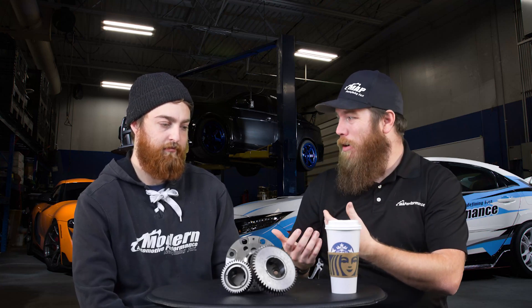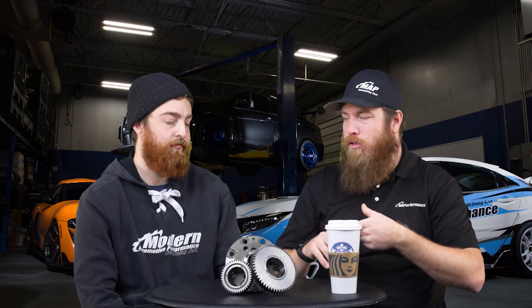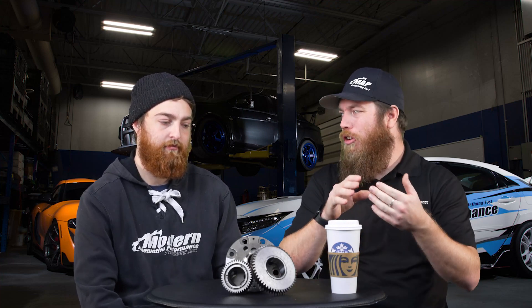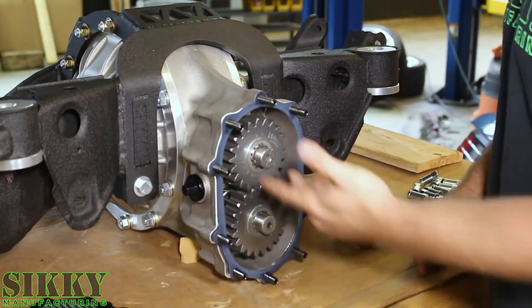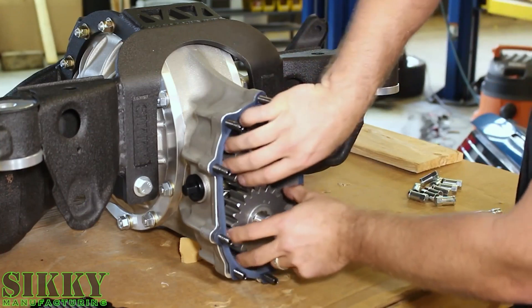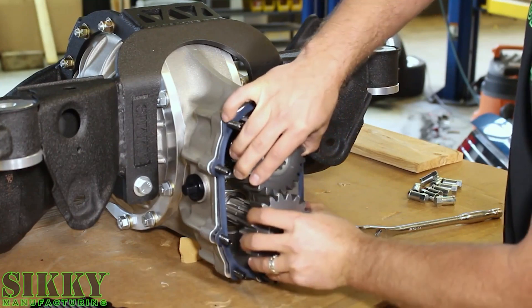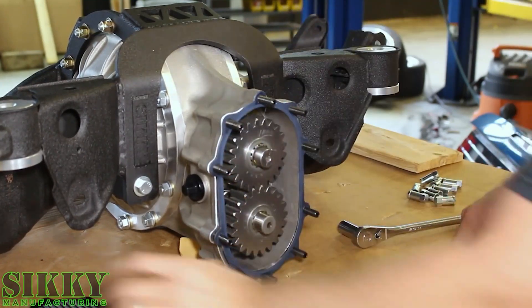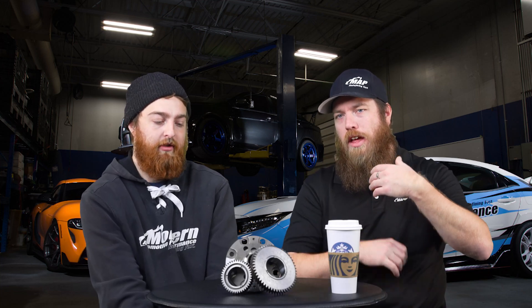One of the interesting parts about gear sets is the ability to carry a spare differential and just swap it in and out — much easier than swapping transmissions. Now in professional drifting and professional road racing we're seeing a much larger use case of quick-change differentials, where you have a rear cover, a main pinion and drive gear, and then gears in the back that you can pop a cover off, change out, and change your gear ratio kind of on the fly. You can run anywhere from a 2.2:1 all the way up to a 6:1 gear ratio — at that point it really comes down to packaging, how big a gear you can fit in the case.